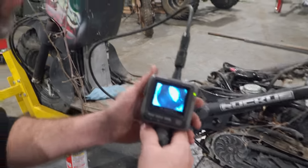Yeah. Dude, this vine is getting on my nerves. I don't seem to have enough compression. Dude. What's going on? There's like no valve lash. Oh boy. We saw the cam moving the valves, but it's not loose. It's holding the valve open. Oh, so we're getting leak down. Yeah. Okay. So the little bit of compression that we felt is mostly slipping past. Yep. Oh, great. Okay. Where's your little magnetic? Hold on. Right here. This is a mechanic's favorite tool. Okay.